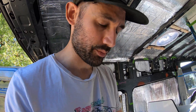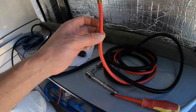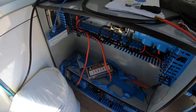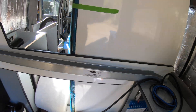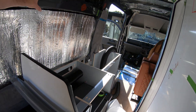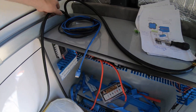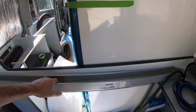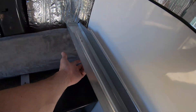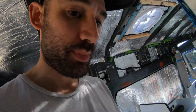Off camera, because you've seen this all before, I've just run my secondary 16mm positive and negative. The first lot went to the 12-volt fuse board, and then I've got another 12-volt fuse board up here somewhere — that means we haven't got to muck about going high-low. I've just run those underneath this bed rail, zip-tied them to the bottom of that, and they're going to come out here, poke through there, and up into this section here which we've obviously not made or designed yet, but that's the plan. We're about ready.